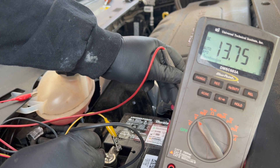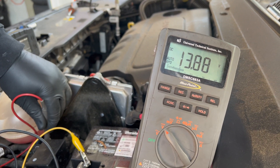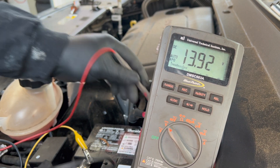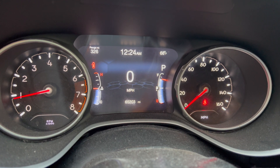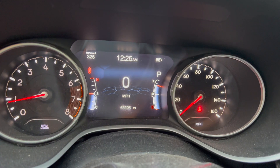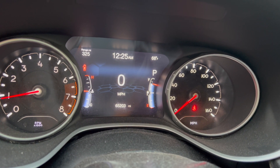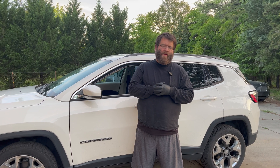The main battery has 13.7 volts — that's good. And the auxiliary has 13.8 volts — that's good too. The warning message is usually an 'A' with an arrow wrapped around it up here on the dash. The warning message is gone, and the orange warning — the A with the arrow wrapped around it — is gone. That shows that the auxiliary battery was also preventing the auto stop-start from functioning.